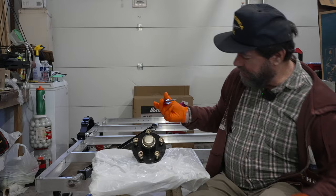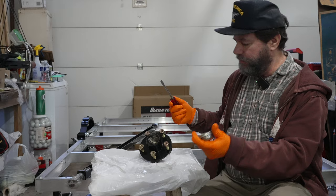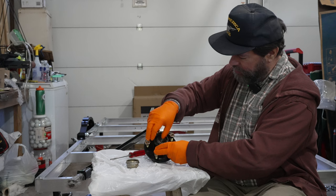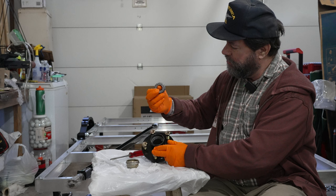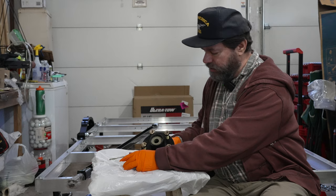It can be a little tricky — tapping it to get the screwdriver underneath so that you can lift the cap. Once I've got it started, I'm just going to turn it as we go around it and work the cap off. So I've got my cap off, and as you can see, the bearings are inside and they've already been greased when it comes in. I don't know how good that grease job is, so probably after I put this together, before I take it out, I'll repack the bearings. Now, we have to attach this to our axle.